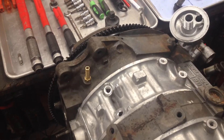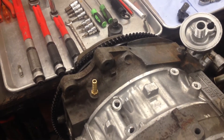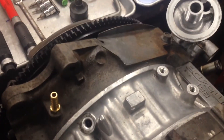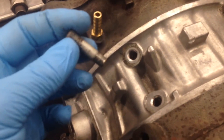Hi guys, we're back with another S6 rotary quick vid. This one's a follow-up regarding the leak we had on the rear coolant hose — it goes to the bottom of the throttle body on the RX8. We've noticed that it was actually leaking through this part — let's just get it in focus there.